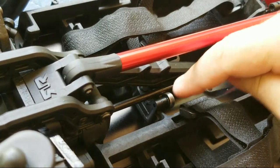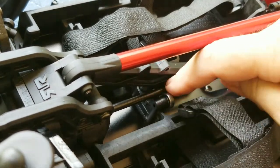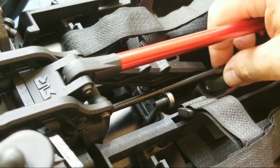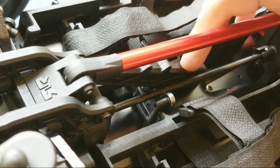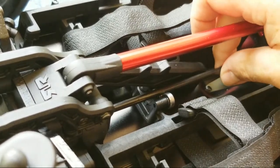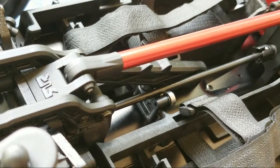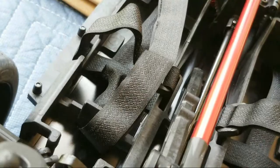And that bearing, supposedly, or the two bearings, is going to assist in taking away the flexibility that happens in this drive shaft, like what Earl was coming across. I think it was his twin motor, that his drive shaft kept hitting his center brace. So my drive shaft seems to be laying on the bottom bearing, and I don't believe that there's any contact with that side bearing. So let's try to zoom in. I don't believe that there's any contact with the drive shaft. So there's no contact on mine, which is fine because I don't think there should be any contact.